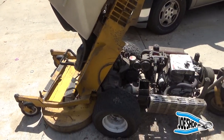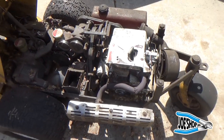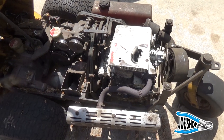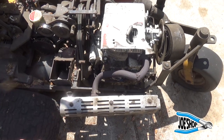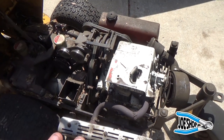Welcome back to the shop. I'm messing around with this machine — it's one of the most dreaded machines I've ever worked on. My father had taken it to a semi-local shop and they did a horrible job. They took the Kohler motor that was in it and put this Briggs and Stratton piece of garbage in it. It doesn't fit right, it doesn't have any power. I took the spark plug out and there's a piece of piston ring coming out — the motor's just shot.